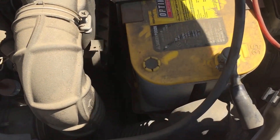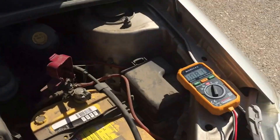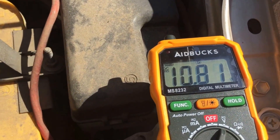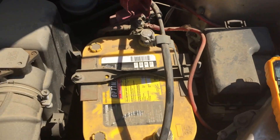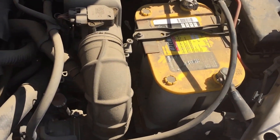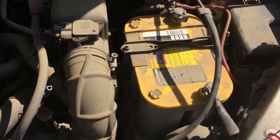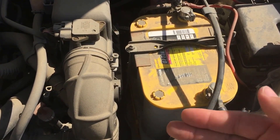I'm going to remove the leads and read it. So I took the battery reading — look at it: 10.81 volts, which is a bad battery. I already knew this because we had to jump the car like 10 times over the past couple of weeks. So we've got to replace the battery. That's a prime example of bad voltage on a battery — it should be above 12.6, like you've seen on my Corolla.